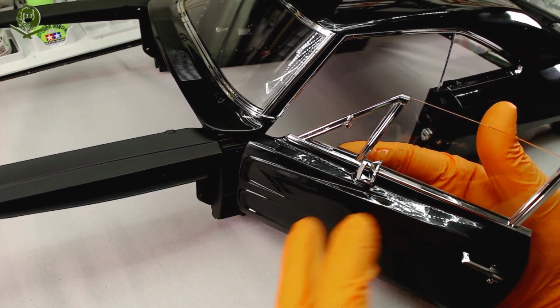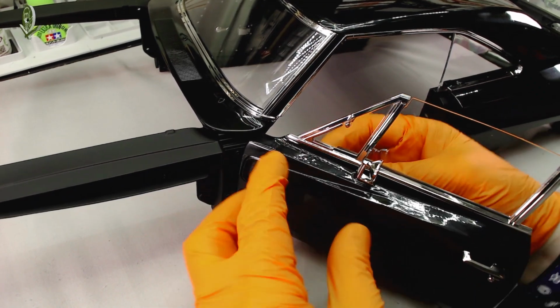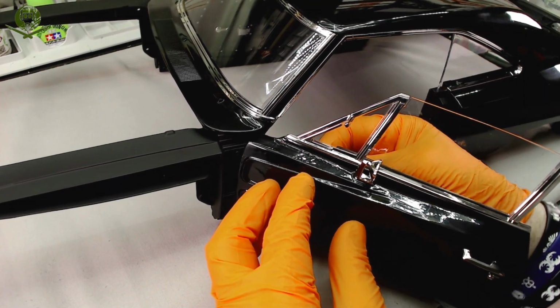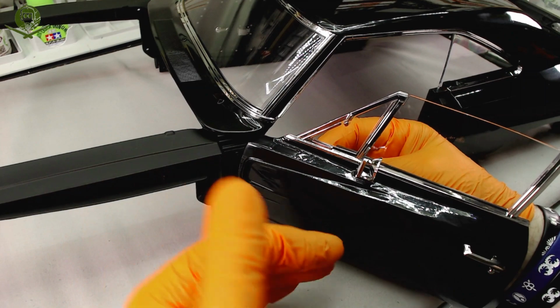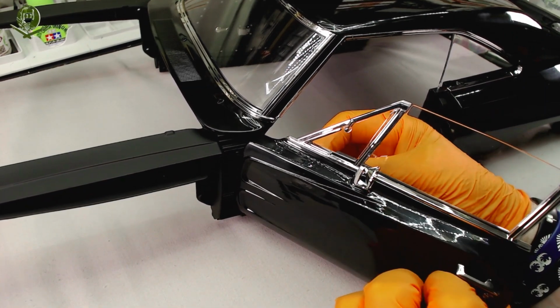And when I built the other door, I realised what you have to do is assemble the cog assembly, get the handle in there and build all the stuff around it, and then you have to really firmly push the winding handle in, and it kind of clicks into place. It plops into place and sits flush with the door liner. If you don't do that, it sticks out and the cogs don't quite line up, and that's why the window was sticking halfway. It was slipping after a certain amount of turning.